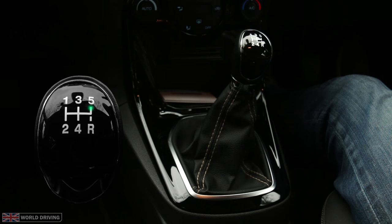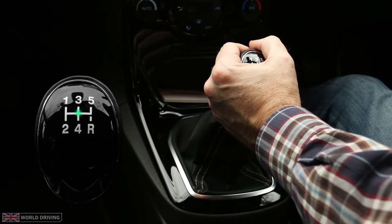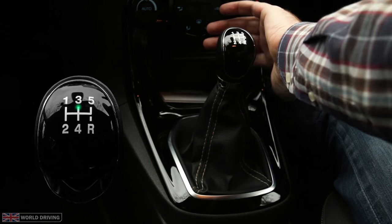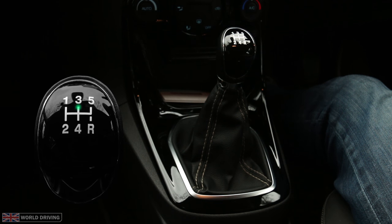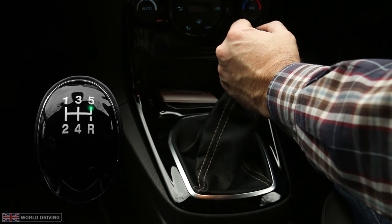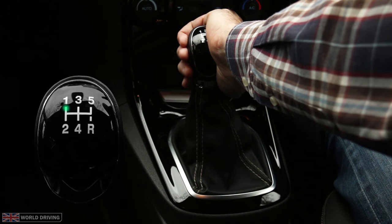Let's try fifth to third. My palm is facing me as I want to let the gear lever spring to the center just under third. Slight pressure backwards so it springs to neutral and then forward to third. Third to first: I need to push against the spring so my palm is facing away from me. Slight pressure backwards to neutral, push left against the spring and then push forward to first. I'm going to change from third to fifth — palm facing me, slight pressure backwards to neutral, push right and forward to fifth. Fifth to first gear: palm facing away from me, slight pressure backwards so it springs to neutral, push to the left and forward to first.